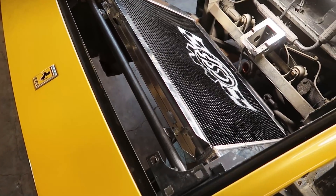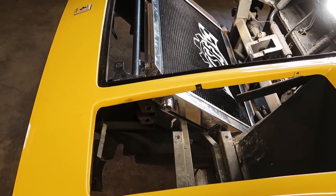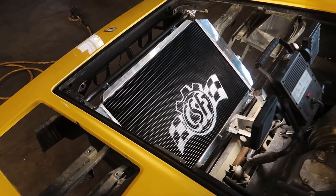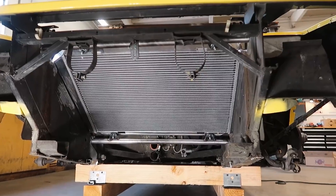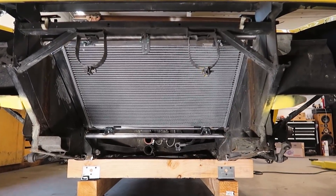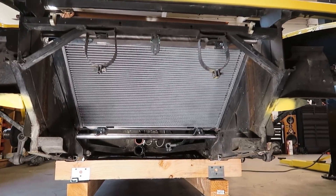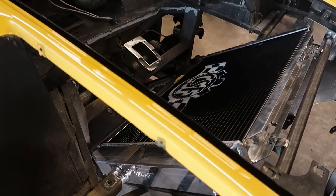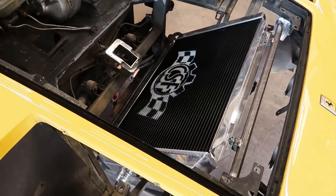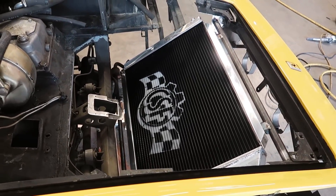Here is the finished result of the mounted radiator — it seals perfectly against the frame rails, and while the seals need a little bit of trimming I'm really happy with how this came out. The rubber is high temp and should be perfect for this application. The radiator really does fit perfectly between these frame rails and I'm just ecstatic with how the entire project turned out today. I'm glad I also didn't have to modify the radiator at all so far. Seeing it from underneath is exciting as well because there's a lot of ducting there and it has required no legwork — we can improve it further down the road. I don't think we're leaving any cooling capability on the table and I think it's going to work perfectly for the level of power I'm hoping we're going to make when this thing actually runs.